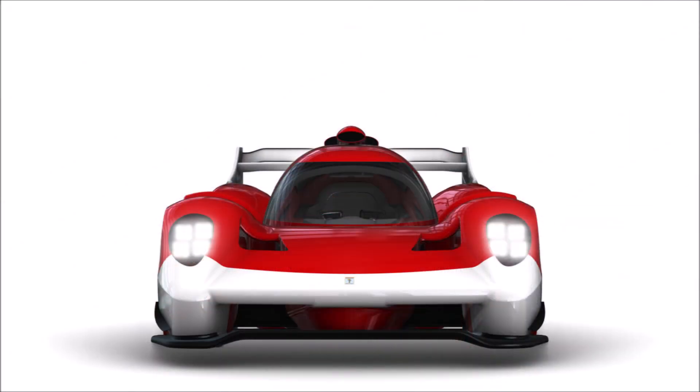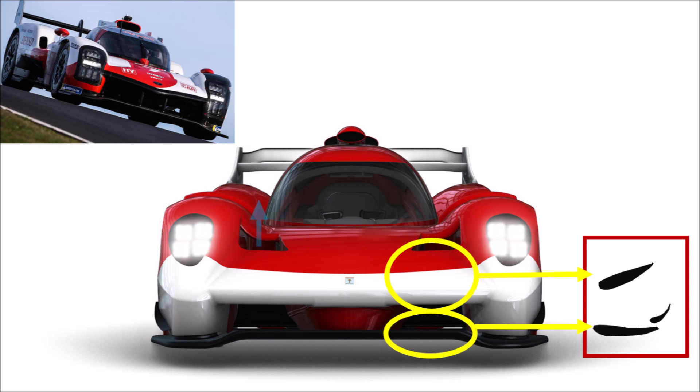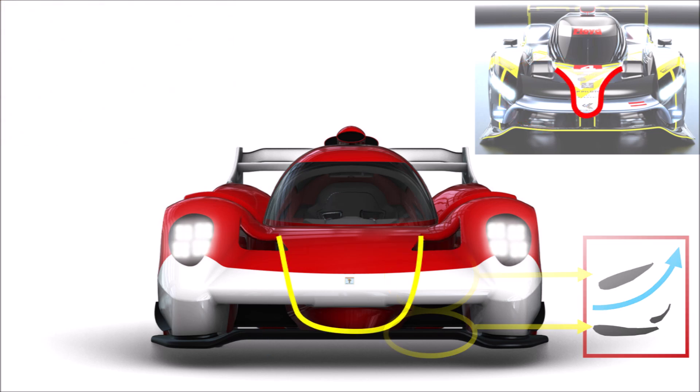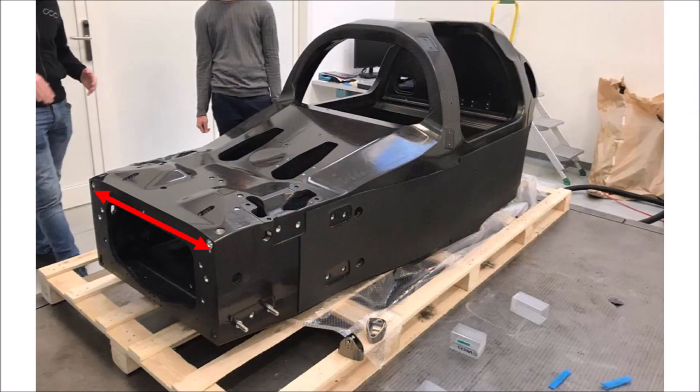We see a front with less air intakes compared to the Toyota and it looks like it has a single upper element with no additional flaps like the ByKolles. Glickenhaus has no hybrid system, just as the ByKolles, but for that it has a pretty fat nose. At the very beginning of the project Glickenhaus said they wanted to use a hybrid system but decided not to use one later on. The fat nose might still be there because they developed the crash structure already and that is a lot of work to change afterwards for a small team like them.